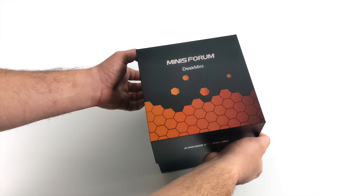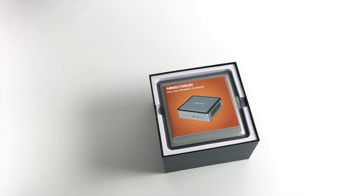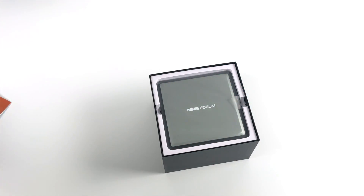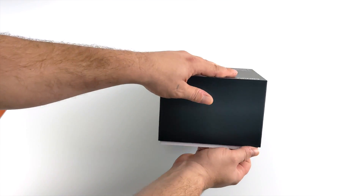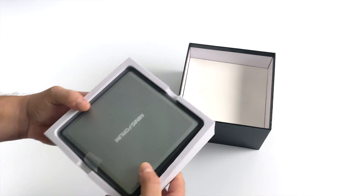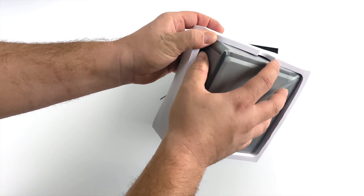This is brand new to the market and it's powered by the AMD Ryzen 7 4800U — eight cores with 16 threads and built-in Radeon 8 graphics. One thing I really love about these mini PCs from Minisforum powered by these 4th gen Ryzen APUs is we do have the ability to run these at the maximum TDP. With this one it's around 30 watts, but I find that 25 watts is kind of the sweet spot with the 4800U.